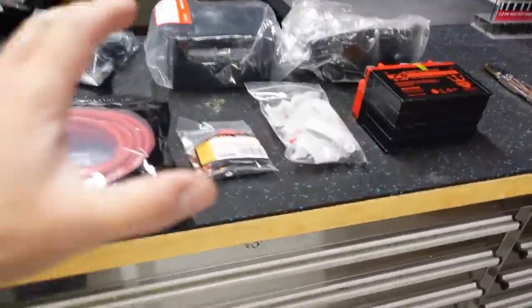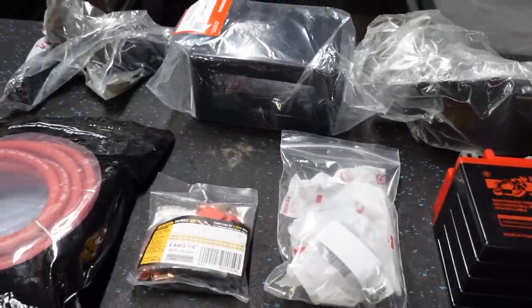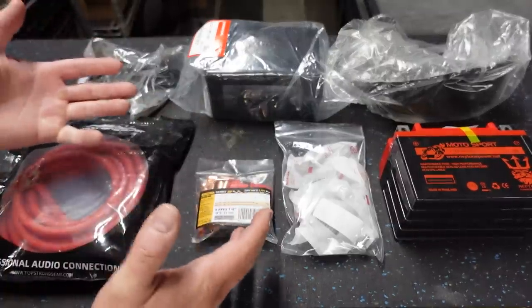So what I'm gonna do is try to alleviate the problem by upgrading to a 400EX battery. I'm not gonna do a full step-by-step tutorial because I'm not sure if this is gonna work. But because I know this is a common problem — I've met several guys with KFXs out on the trails and from the comments you guys have given me — I know the battery thing is just weird. Some people have done battery relocates already and put a bigger battery. So I'm going to do the job, stop along the way with little updates, and hopefully it will work out. Now the parts to get this job done — I've got laid out here, at least what I planned. Maybe I'll need more. But we've got some heavy four-gauge wire — that should be great for our battery cables — and we've got terminal ends.